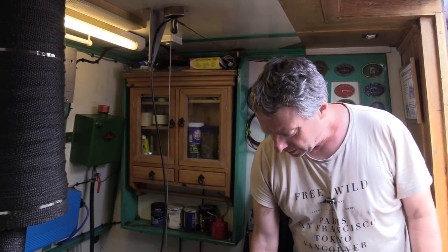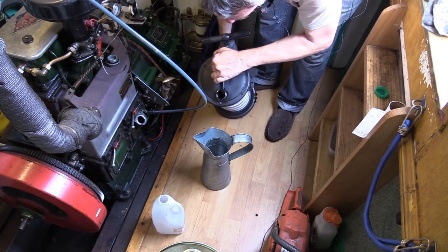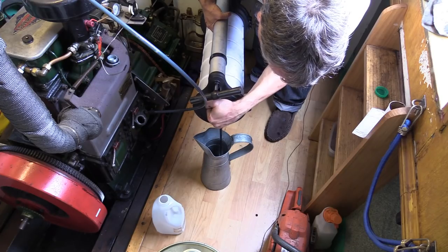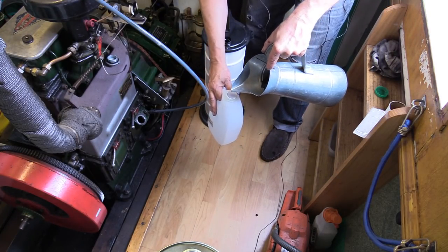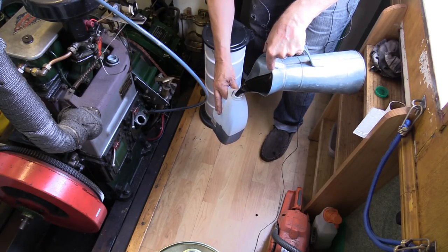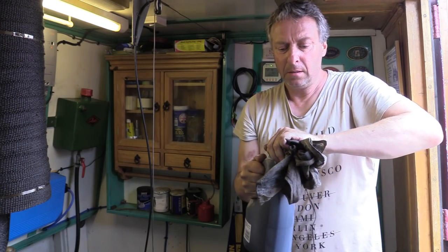The vacuum pump has filled up to 10 litres, and there's about another litre in the engine. So I just need to decant into some old milk containers. This is quite revolting stuff and I'm being very careful not to get any of it on my hands, or as little as possible. What I should have done really was washed the containers out beforehand, because they smell a bit cheesy. Well, that's two litres — I shall now extract the rest of the oil.